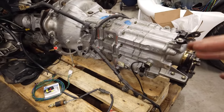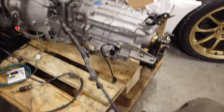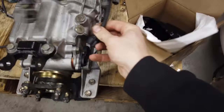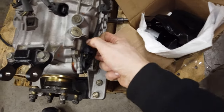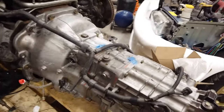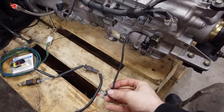Let's start with the easiest wiring and ramp it up. This is my automatic wiring loom with a bunch of plugs. The one you want first is the longest black one — it plugs right into the speed sensor. Done. On the Getrag V160 transmission there are only two plugs: one for the RPM sensor and one for the reverse light switch. Mine is damaged so I'll need to do some soldering and shrink tubing, but basically you want to connect these two wires to the corresponding wires inside the connector — the yellow wire on the top right and the black-and-red wire in the back.